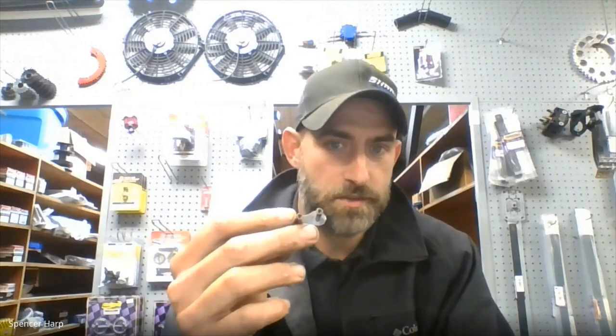Whether you're doing it on a 35 chain or something else, a rivet link — yes, they're inconvenient because you have to replace them, there's a single use — but you take this link and there's a tool that brads out the end of it, and you don't have to worry about it coming out or losing it and busting a case.